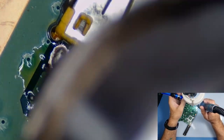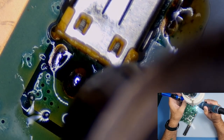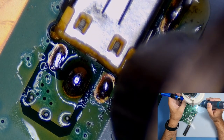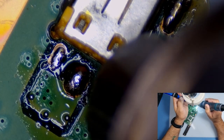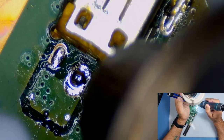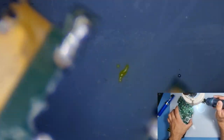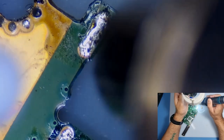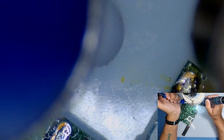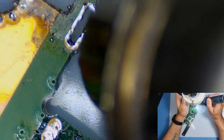It's at the end of my desk really, but I'm doing it for purposes of video. As you can see, that solder is starting to get a little bit shiny and it's moving around. There you go, can you see that? Okay, we've got this little sucker. To be fair, the socket's moving already. I can just pop that off, you see? Knocked it off. We've got a nice clean break. And that's the benefits of using low melt solder. Oh, it has got a hole, so let's get all that solder out. Nice clean hole there.